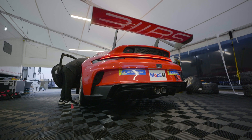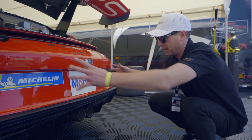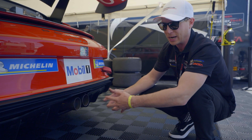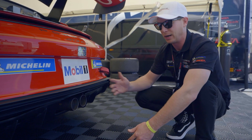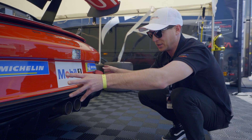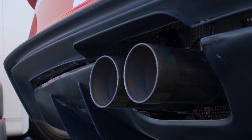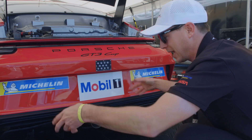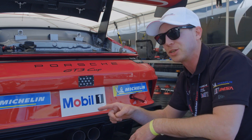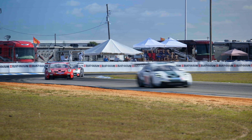Underneath the car, Porsche has the exhaust hidden with this awesome diffuser. This is one of three options available on the 992 GT3 Cup. As standard, the car is delivered with one big center muffler, two link pipes, and a quiet muffler for tracks in Europe, Asia, or the U.S. where noise limits apply. There are also two side mufflers that replace the link pipes. For us in America, we're running what's known as the super cup pipes — right off the headers through the cat, then two straight pipes shaped in a nice S-curve.